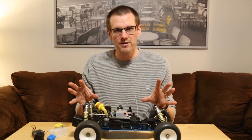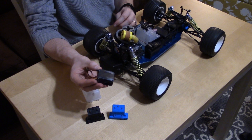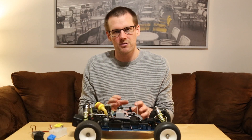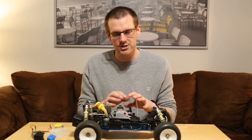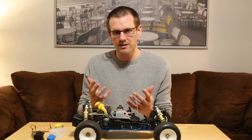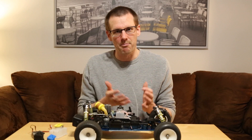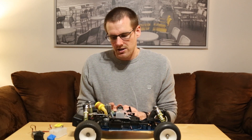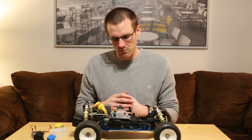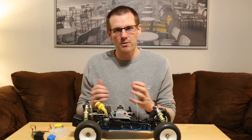That led to another question: if I got a servo that looks this bad, why is it that bad? I noticed, and mentioned it in the previous video, that the car was extremely dirty — there was dirt all over the chassis plate and it looked like there was nitro fuel all over the place. It looked like raw fuel that wasn't yet burnt or exposed to combustion. I then tried to start the vehicle, and I have a clip of me trying to prime it, where I noticed that fuel was coming out all over the place.